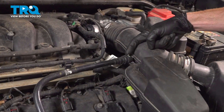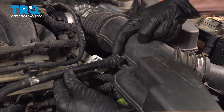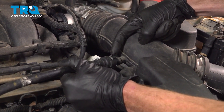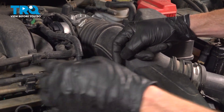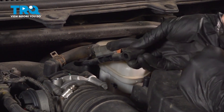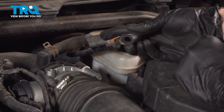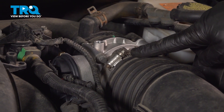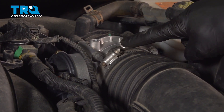Now we can make our way up that air inlet tube. We're going to disconnect this by grabbing onto this little gray lock — give that a little tug and pull this off. Set this aside and continue following it up. You're going to find that you have a hose in this area. Gently pry this out of place, give it a quick squeeze, and make sure it is soft and pliable and not torn, worn, or damaged. Continue on to your 8-millimeter-headed clamp that holds the air inlet to your throttle body.